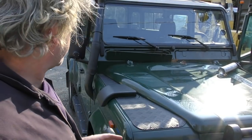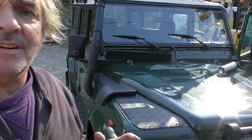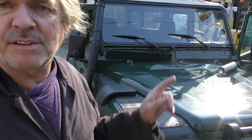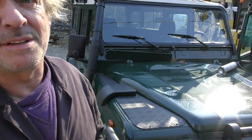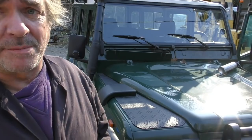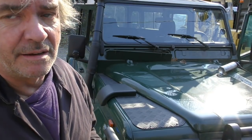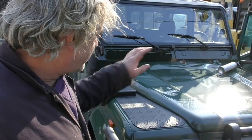On this side I'm going to try a different technique — I'm going to tip the vent forward and see if I can get the centre pivot bolt out. It seems to be easy, but for some reason on these Land Rovers the vents never seem to go fully open or fully closed; there's usually a little bit of a discrepancy. I've got that one on, that looks okay. The threads on one bolt aren't very clever. The problem is they're a captive nut on the vent, and once that's stripped it means a new vent — or you can try to tap it out, but the tap's got a point on it and you'll go through the aluminium.